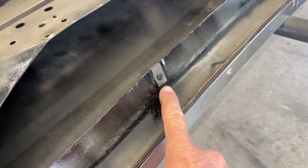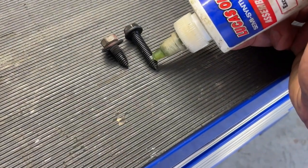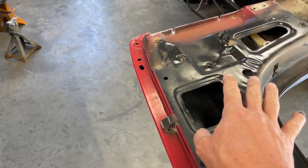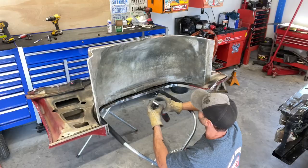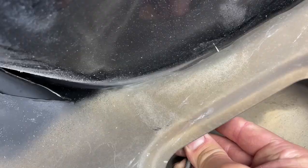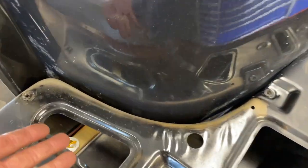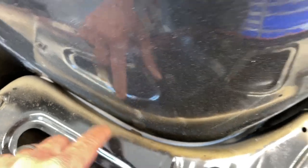Now reinstall that center U-nut only, and I'll be using the longer hardware from Sloshtubs. I tend to use a little bit of engine assembly lube on hardware, especially on these older trucks with older threaded areas — it lubricates the thread nicely, and it doesn't drip off. Start with just running the first center bolt in tight. Then scribe the holes on the opposite side of it, drill those, and run them up tight as well. What you don't want to do is mark all of them when there are gaps, because it'll pull the tub away from the other bolts. Start in the middle, work your way out one at a time until you've scribed, drilled, and tightened all the bolts.